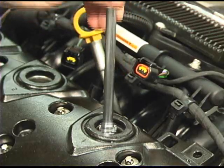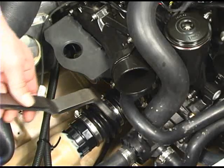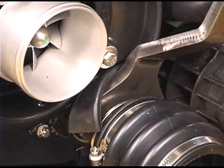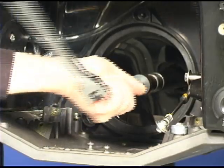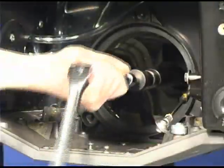Remove all 3 stick coils and spark plugs. Install the drive shaft wrench onto the flats of the floating ring. The drive shaft wrench must be held to keep the floating ring in position when the drive shaft is being turned. Using the drive shaft adapter and breaker bar, turn the drive shaft clockwise to remove it.